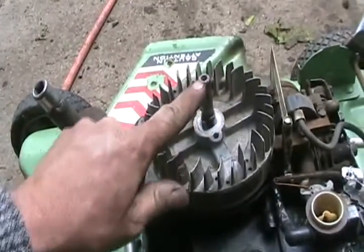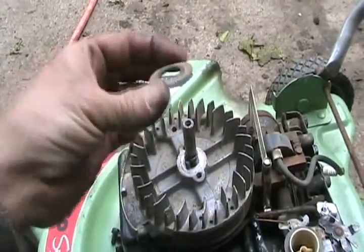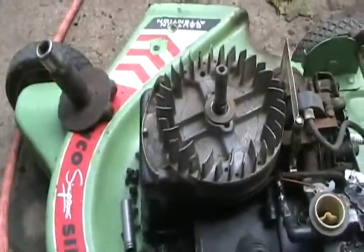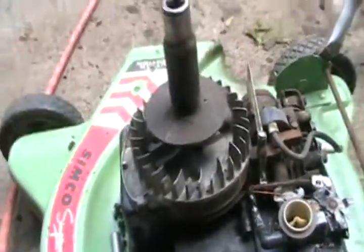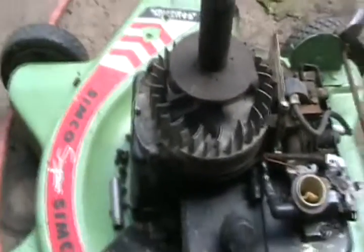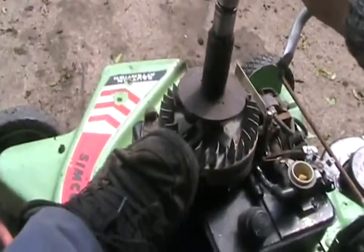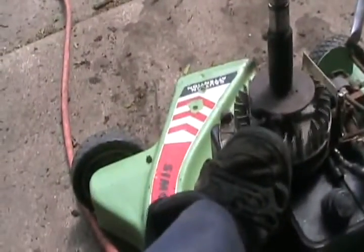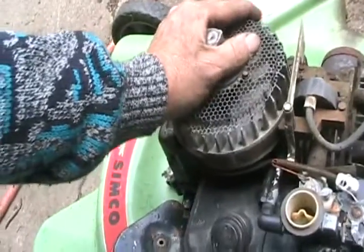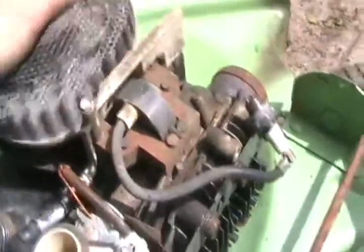Don't forget your oil. The washer goes on with the highest point pointing up because it's slightly conical in shape. Start those threads, then put it on with your homemade tool or your wrench and hammer, nice and tight. By checking the position of the three magnets, quickly rocking it back and forth while it's turned on, I can see that I've got spark — so we're all set.